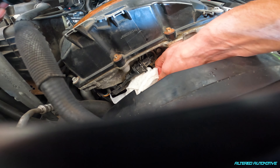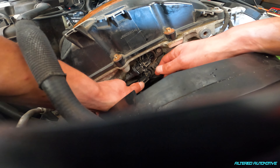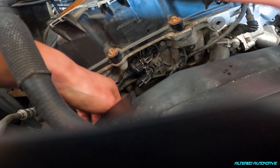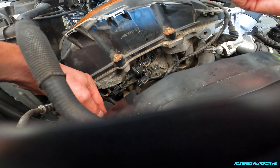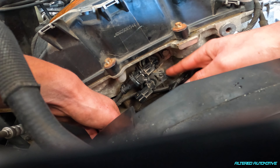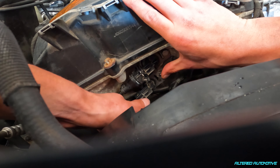This one leaked a lot more than the intake. One thing — make sure you put the o-rings back on these before you put them back in, otherwise they'll leak. If your o-rings look bad, I would recommend replacing those — that could be what's causing your Vanos issues. In my case, I'd consider that these have been cleaned or replaced before. These look pretty good for having 80,000 miles on the car. Wasn't really any buildup on them that I noticed.